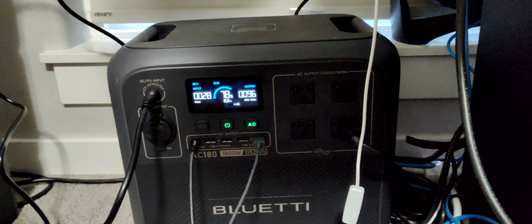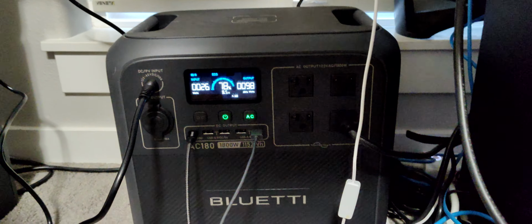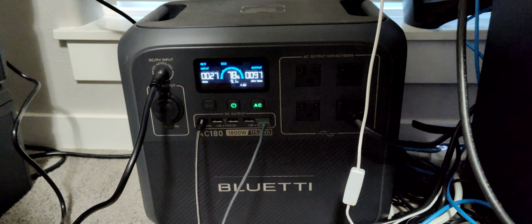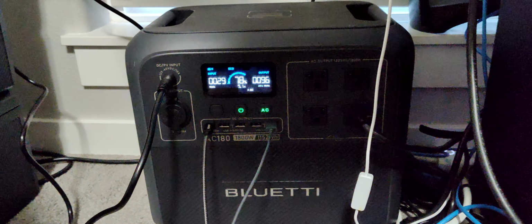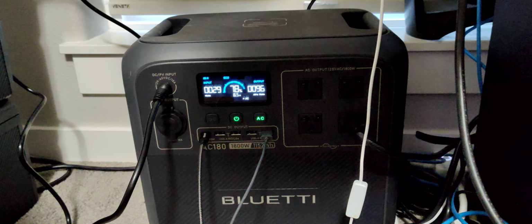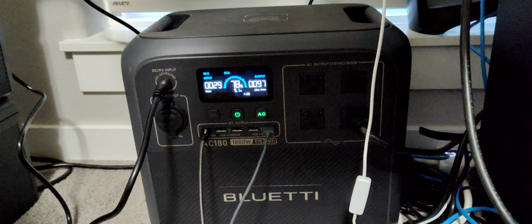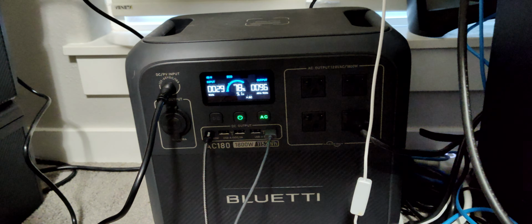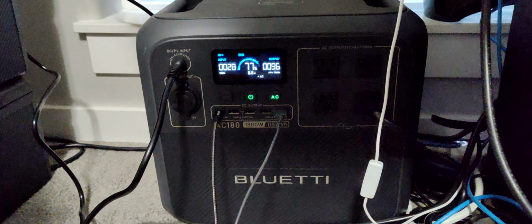It could be because of how I'm using it. I've got it plugged into a relay switch, a smart switch, that's triggered by a relay, and relays kind of mess with the signal a little bit, kind of bouncy because they're a mechanical device. That could be screwing it up. I'm not sure, but from time to time, the UPS function will fail and the PC will restart.